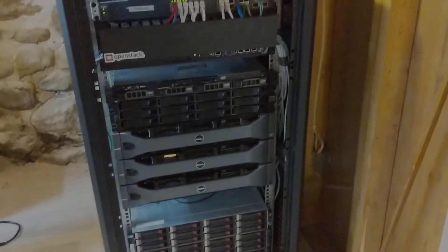I've also picked up another LSI 9211 HBA card. The chassis has 12 front-facing drive bays, and to use all 12 you need three SAS ports. The original build only had two ports on the LSI card, so I picked up another one to enable the top row of the disk chassis. We're going to pull the server out of the rack, shut it down, and start swapping parts.